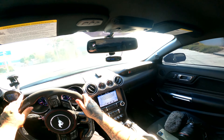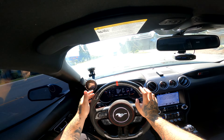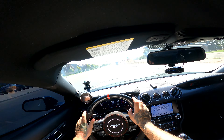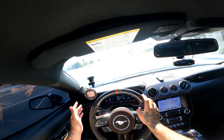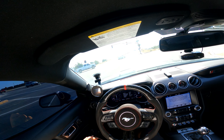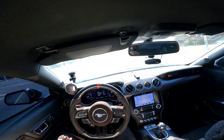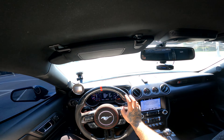We're going for a little drive — it is hot as hell out. The AC is blasting to cool down the car. IATs are dropping pretty quickly; it started out at about 153 and it's already at 144. As you sit at a stoplight and slow down, it climbs back up to 145–147. IAT1s are at 113, which shows you how hot it really is outside. I need to look into getting a lens filter for the GoPro to block out the sun.